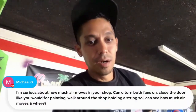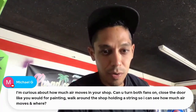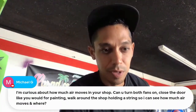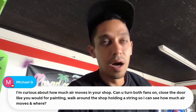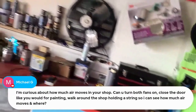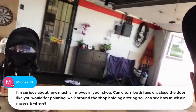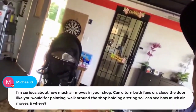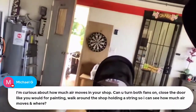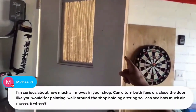Regarding air movement in the shop: when I'm painting I just turn the fan on, close the garage door, and close the door that goes into the kitchen of my house. I'll leave that door cracked open because it's not enough ventilation with just the one filter — I'm depriving the system. It's not enough; I need to cut another hole and add another filter.